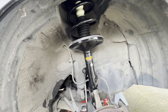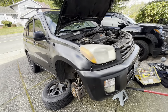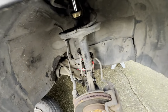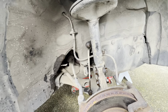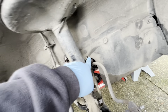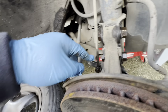I have a 2002 front wheel drive RAV4. Today I'm going to show you how to take out this whole unit right here - the front strut assembly. It's very easy. I'll show you all the bolts you got to take off: this one, here's number two, that's number one, and then these two big ones - three and four.